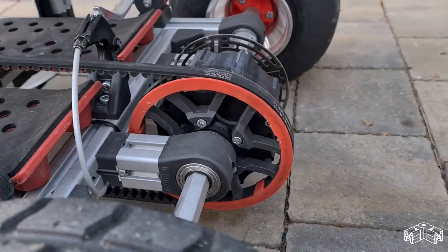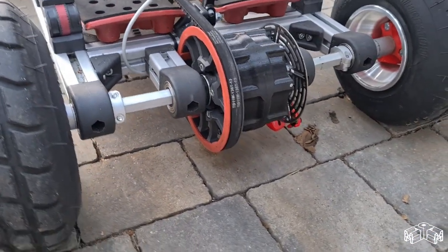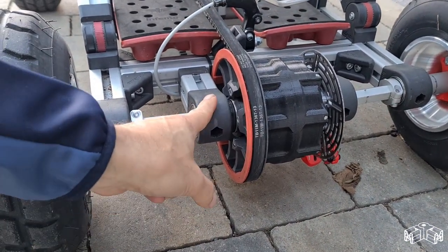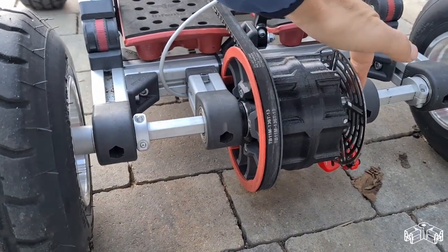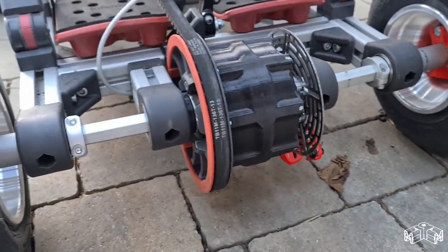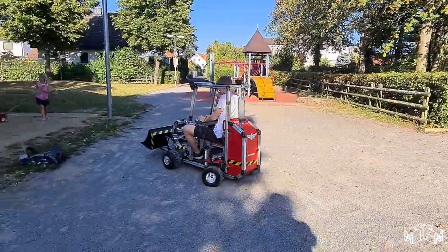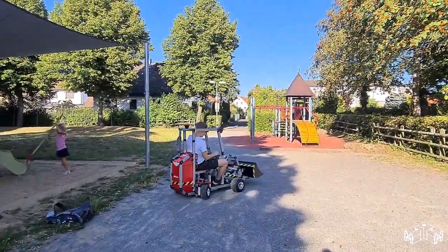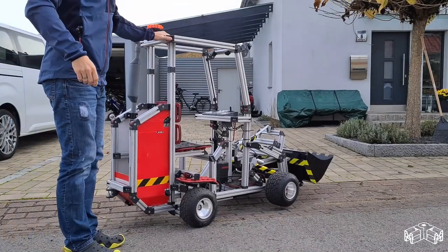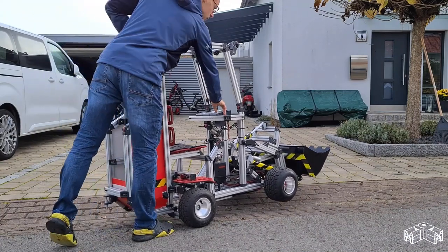For using this diff in an Infento ride, we have to install two half-axles, each half-axle supported by two bearing blocks, because the differential cannot create a rigid connection between two axles. On an even and paved road the differential works inconspicuously, whereas on uneven or slippery ground the ride comes to a standstill as soon as one of the two wheels is in the air.